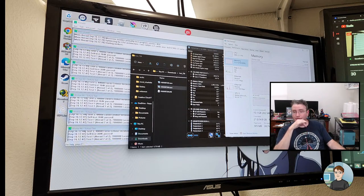So you've updated drivers, updated the BIOS, you've tried switching the driver for the trackpad to the more basic one instead of the Synaptics, I think it was. I think you said you tried all that. Good question. Are you just relying on Windows 10 to get the drivers, or did you go to the manufacturer? Yeah. And the manufacturer's HP.